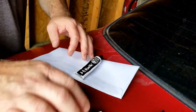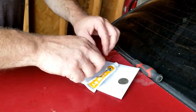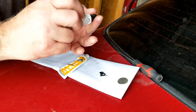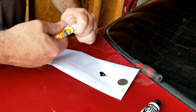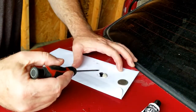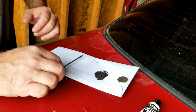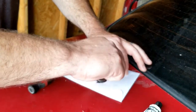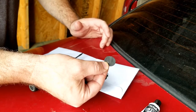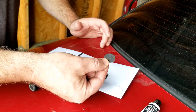To do this repair we're going to use JB Weld. It's not only good for crankcases, piston rods, and connectors — mix it out half and half. One half is resin, the other side is the hardener. Mix that until it turns gray. All I'm going to do now is take my nickel, coat one side of it with JB Weld, apply that, then push the clutch back down and put the nickel over the hole that was there. Let the clutch reset itself — this will stick between the clutch and the switch until it gets hard, and then we'll test it.